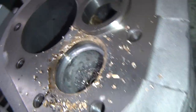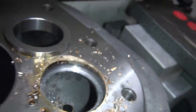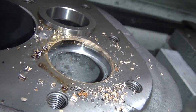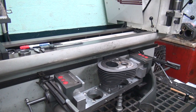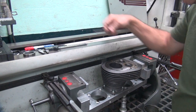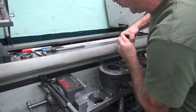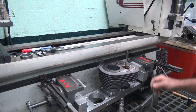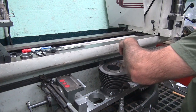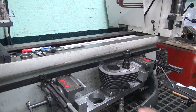Junk. I want to cut deeper. See, it's half brass and half iron. It's a toss up. Yeah, I think I need to go down deeper. That brass is more cosmetic than real world, so need to go deeper. More holding power. Lose a lip or lose a lip. Just how it's gonna be. Gotta get rid of that chatter though.